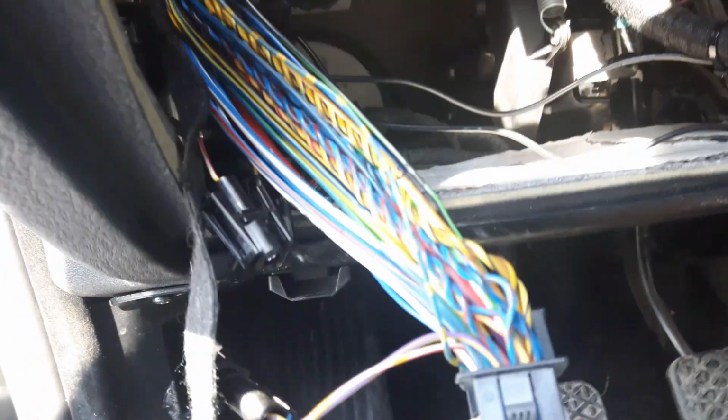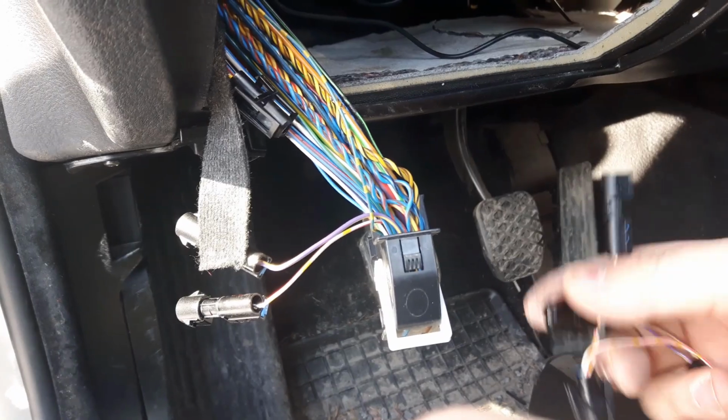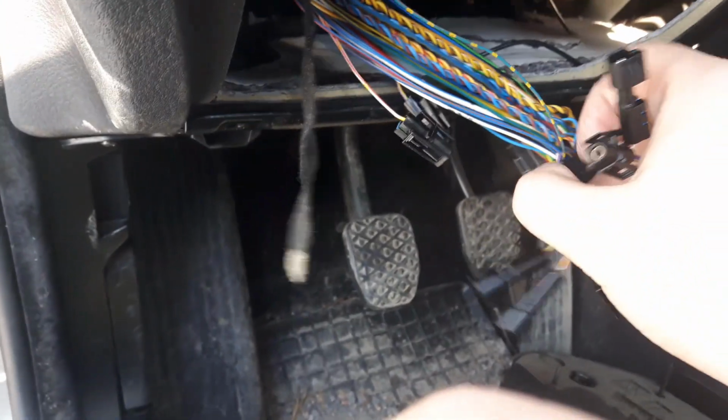Okay, so now we'll, and there, and this is where you need to snake the wire, the ECU from that white plastic thingy, and that where I'm pointing with my pliers is a hole from where you can snake the blue wire in to the same compartment as the ECU without any worries of needing to make a new hole or something like that.